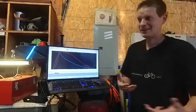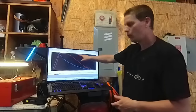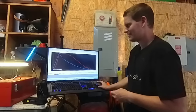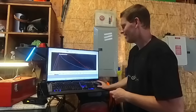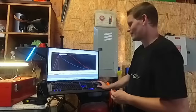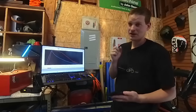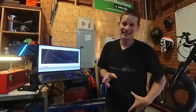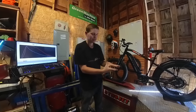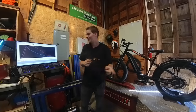We have to keep in mind that this is only a single gear, kind of like a hub motor, so it's a little harder for it to maintain power if we had another gear to shift into — we could hold that longer as speed increases. But it's got so much power it doesn't really need it. It's really interesting that the torque just shoots straight up to that peak of 62.99 — basically 63 foot-pounds. In Newton meters, 63 foot-pounds of torque is 85 Newton meters. I see many hub motors rated for 80 Newton meters of torque, but that's at the axle — we're getting only about a quarter or a third of that at the wheel. So this motor is actually delivering all of that power to the ground.